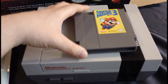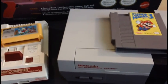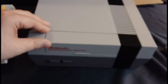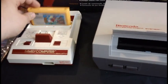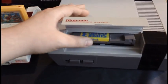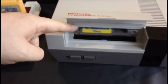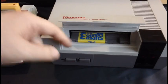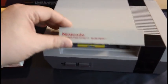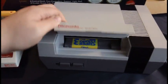Here's a look at the NES console itself. Compared to the original Famicom from Japan, it's much bigger, and the actual cartridges themselves are bigger too. It has a weird front-load design — unfortunately they ditched the top-load design of the Famicom. This meant the game had to be pushed in to the pin contacts, making contact only with the top row of pins until you push it down. It has a complicated spring-loaded door mechanism, and unfortunately it's less reliable over time. A top-loading system generally has fewer problems reading cartridges than these front-loading systems do.